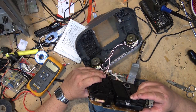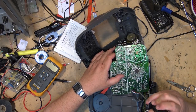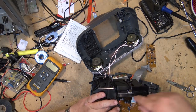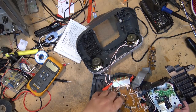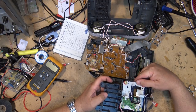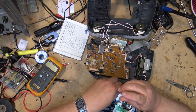What I'm interested in is whether this sled is moving. To get at the bottom of the mechanism I do have to remove a couple more screws. I'll remove the board, and what I want to do is pull the laser assembly out so I can check to make sure it's free running, and we'll also look for any connectivity problems on the ribbon cable. Now I've got the optical pickup separate from the rest of the unit. I'm going to remove the optical base from the chassis assembly so I can get at the gears, check that nothing's sticking, and lubricate it while we're at it.